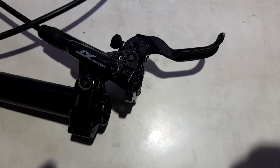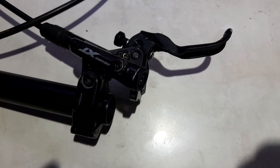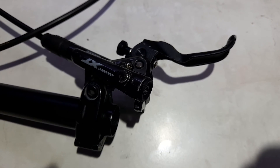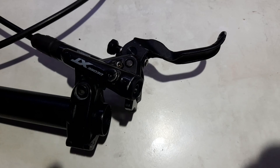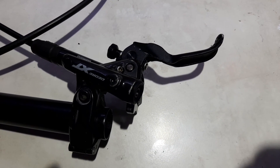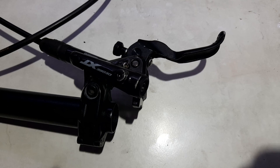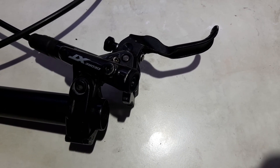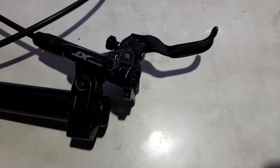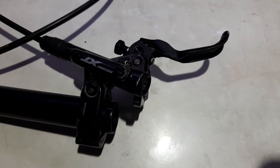It needed a little modification to that bit of plastic - it came out fine but to get the grub screw in at the right angle without risk of cross-threading, I ended up cutting a small semicircle out of it so the grub screw went through at the right angle. That's the end cap held on. The only thing left is to clean it up, recharge the system with oil, and we're done. Hopefully this was helpful - sorry about the quality. Hopefully you'll end up fixing a brake you might have thrown away and save yourself some waste and money. Good luck.